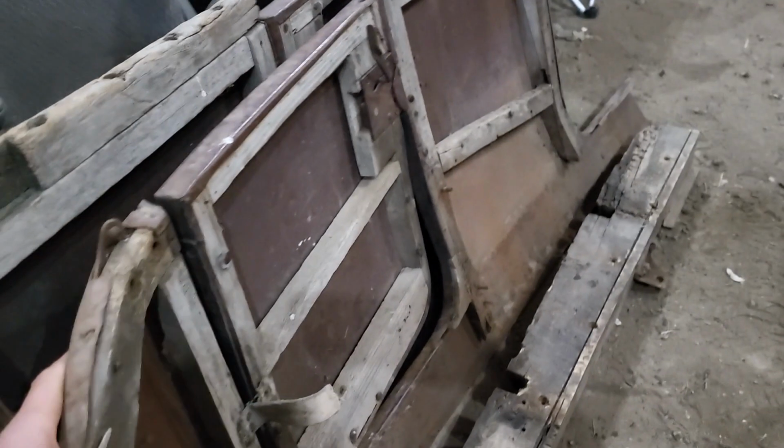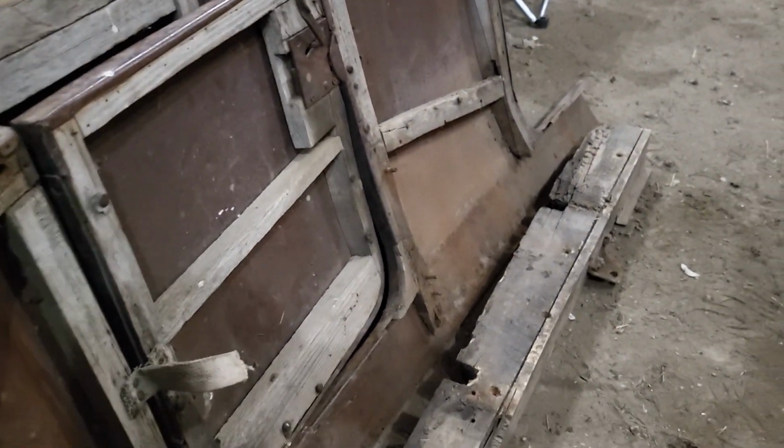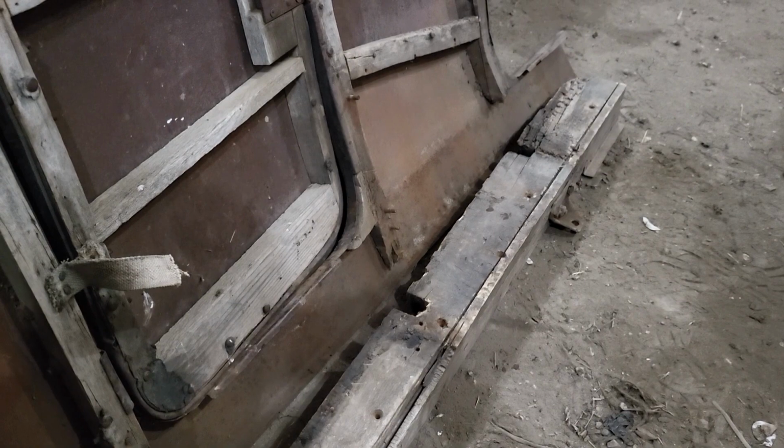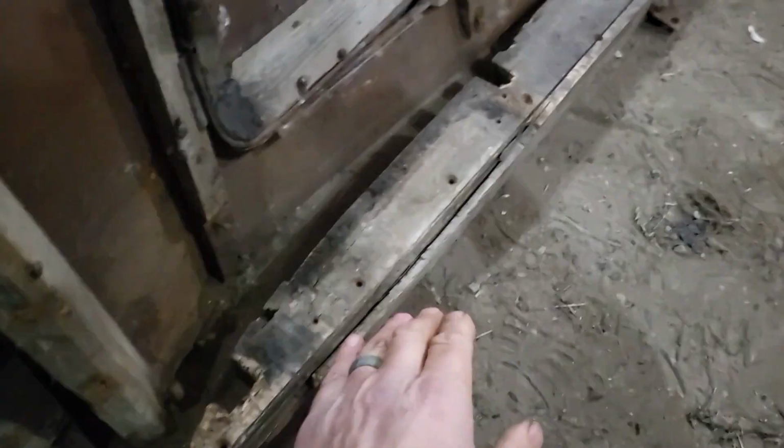I mean, there is a frame, right? The chassis has a frame, but the body itself, the metal has absolutely no strength or structure. It's a complete floppy piece, and it's the wood that holds it in shape. And so initially I thought, well, if I could get new frame rails put in, it would maybe work to just reuse this wood, because it's kind of here, and really even on the bad side, which is the worst one back here, the driver's side. But I've determined that it's not going to be the case.